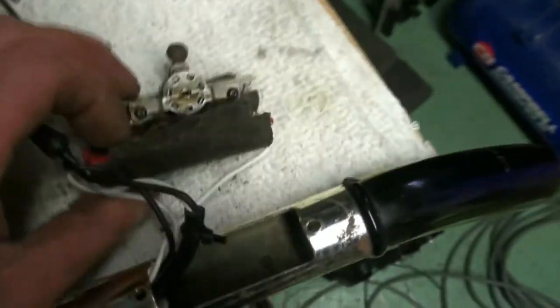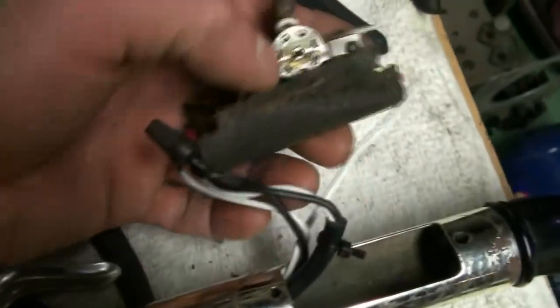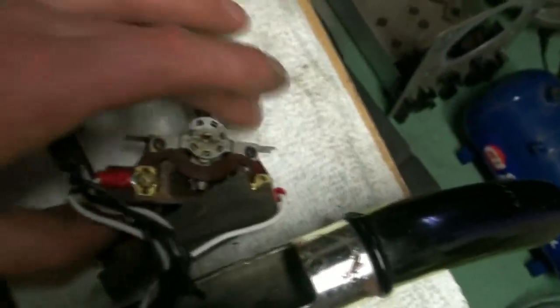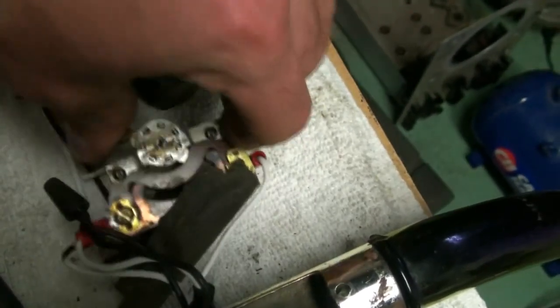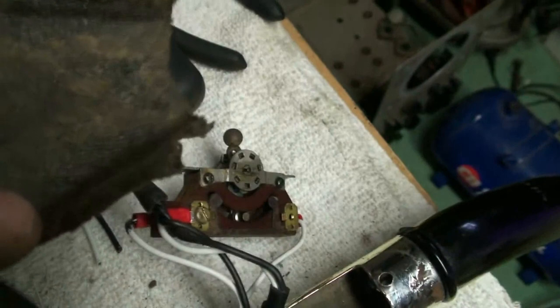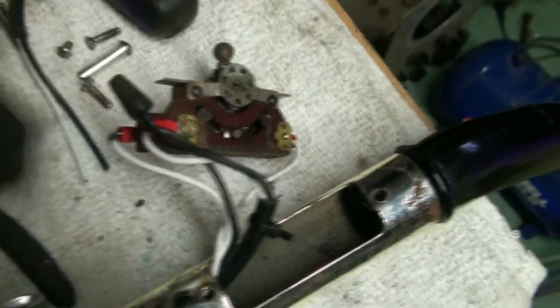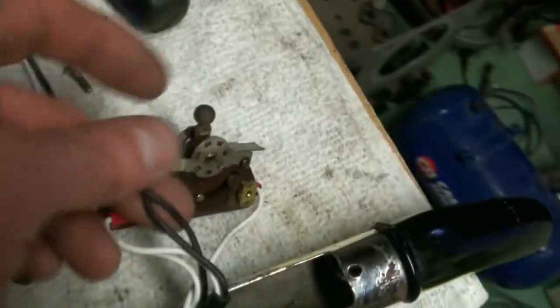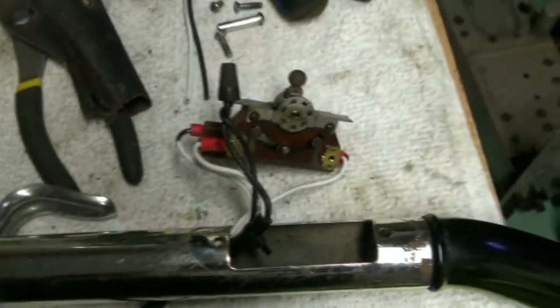Okay, so the switch is installed — well, wired in anyway. And I lubricated a little bit here, so it works a lot better. And this is a little piece of cloth — I'm not sure what it's soaked in, asphalt or what it is — but that wraps around the switch so it doesn't make any contact within the handle here. And the wire is just going out the back. And there's the strain relief on the floor there. I just got to get this put back together and get some tape wrapped around that wire nut connection, and we'll get it back together and try it out.